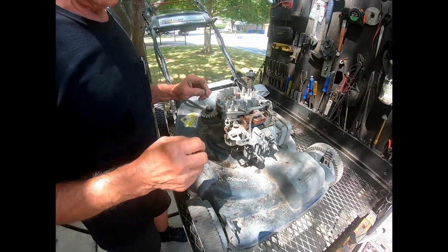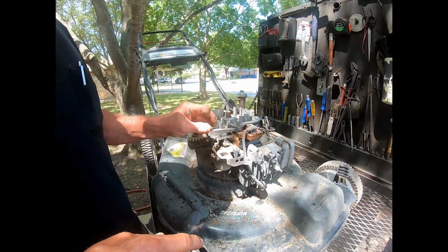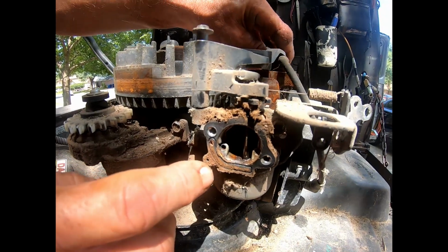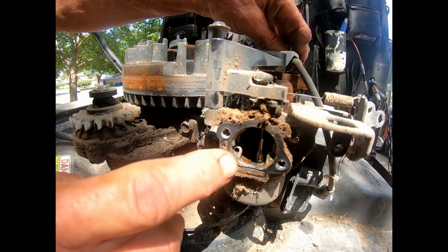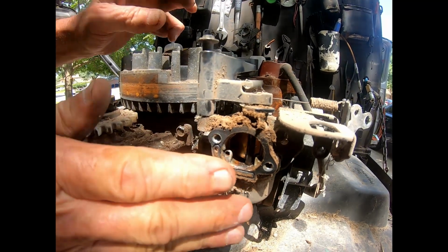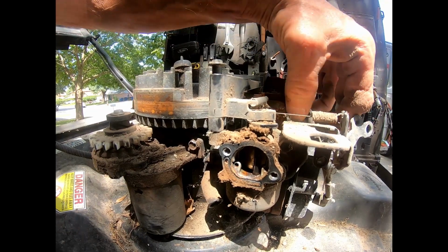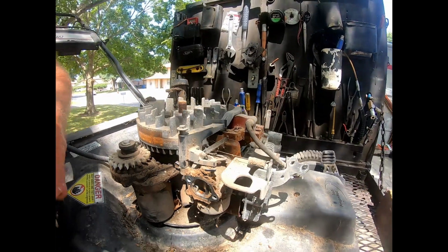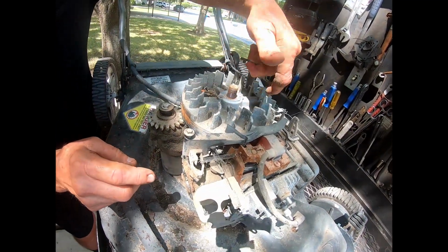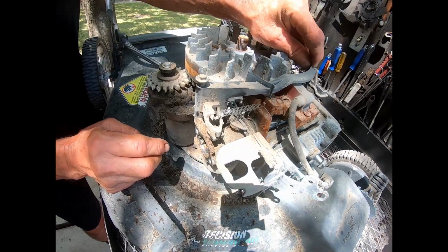So on this one, we'll start with the carburation system on this particular mower. Here you have the choke. Let's see if it's working. Yeah. This door right here is the choke. So when it's not running, this choke is closed, and when you pull the rope, it creates a vacuum which will suck fuel out of your carburetor bowl into the engine and ignite it with the plug here starting. Then once this particular engine starts, the rotation of the flywheel that has these fins on it will partially blow back and open the choke a little bit where it will stay running.